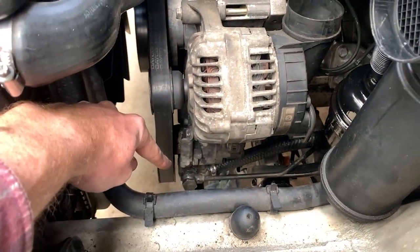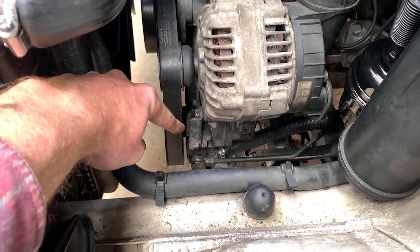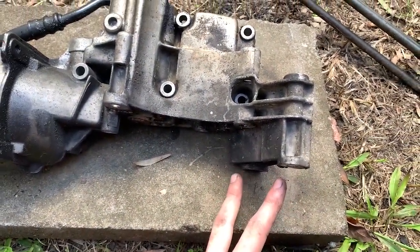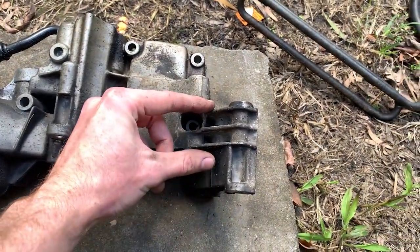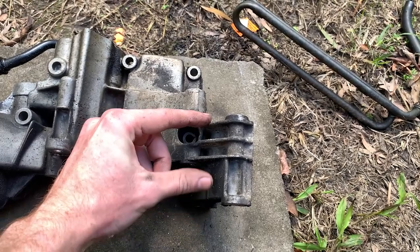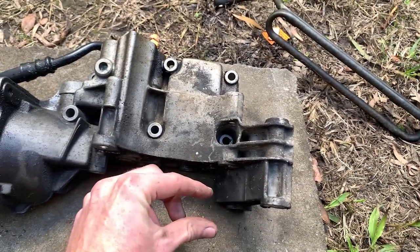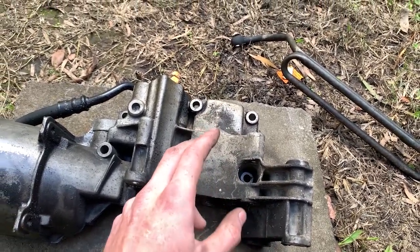As for our power steering pump, compared to the M52 housing, I'll just show you. So these are the two spots where the power steering pump bolts on. For the M50, S50 filter housing, this whole piece is actually shorter, so I'll have to get some spacers machined up to correctly mount this onto the M50 power steering pump.